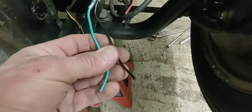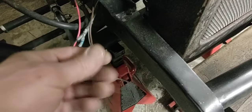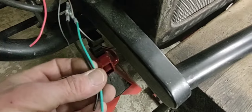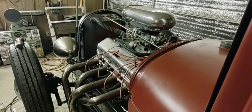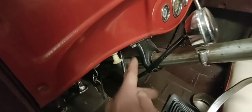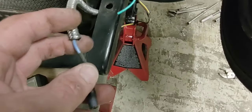I'm not sure which one is high beam or low beam — probably the black wire. I fixed that one wire, got a running light, the blue one would be the blinker, and these two are headlight — one was a ground riveted on the back of the headlight mount. Everything seems okay. She cranks over — battery's a little tired but she cranks. I found out what that extra switch is — it must have been for an electric fan. I traced it from the switch and it's a blue wire. The horn doesn't work — I'll have to figure out why.